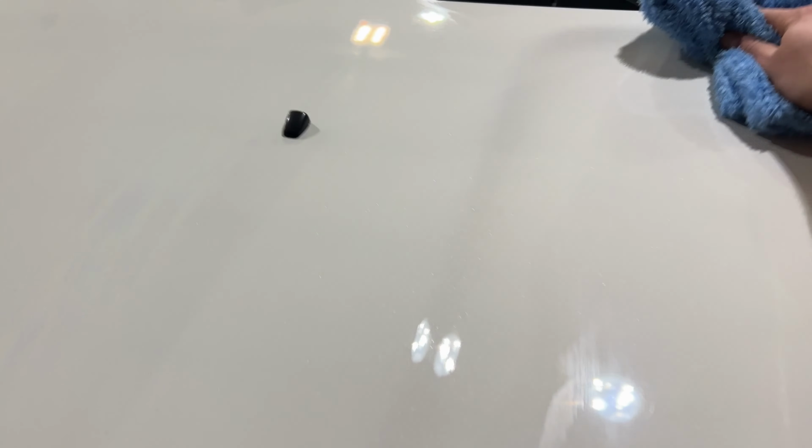So I'm going to go ahead and wipe down the hood. I've already started with some 70% isopropyl alcohol. Make sure that there's no contaminants, waxes, residue from the compound on the hood at all. We don't want any dust or anything in here so it doesn't get in the decal when we're applying it. Want to make sure that the hood is completely clean so the decal adheres properly to the surface and we don't get any issues or contamination in the decal. Once this flashes, I will wipe it off with another dry microfiber and make sure that the surface is completely clean for the application process.